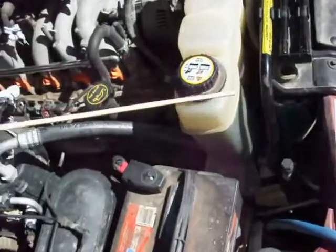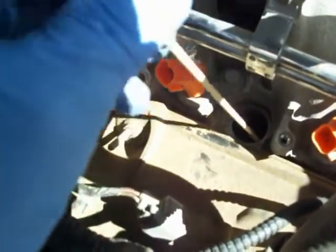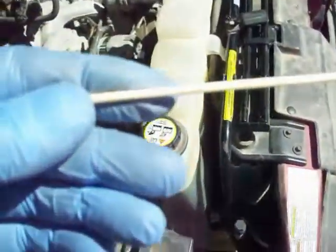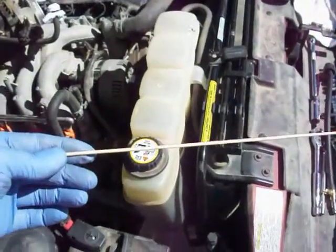The skewer is about a foot long. I'll slide it down into the spark plug hole and see how deep it goes. I can run it along the wall and feel where the spark plug seat is, just bump right over that seat, feel the threads, and drop down into the cylinder. The skewer goes pretty much all the way in. I'll lay it next to the insert tool and find out how deep the insert tool is going to go.